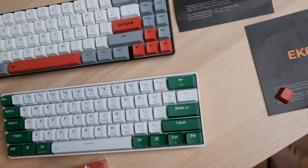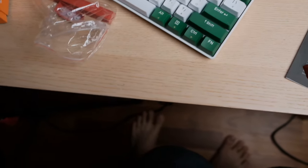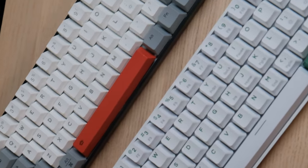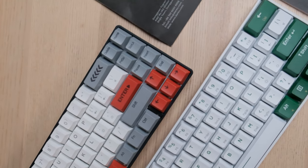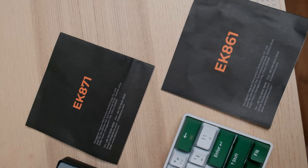I don't really know how to feel about the blue switches. These aren't as interesting to me as the browns. They definitely feel like normal blue switches, but they don't feel like the really fancy, super loud Kailh Navy switches either. These are normal click-bar blue switches, not click-jacket style. Both this and the brown switch have a very similar characteristic of being very highly sprung. Membrane keyboards do have that quality where when you actuate and release, it pops back up really quickly, and that snappy return is very noticeable on these switches. However, I don't really like the sound of these blues — they're definitely harsh and jarring on the ears.